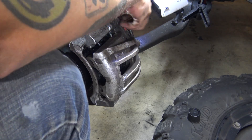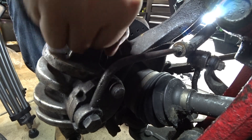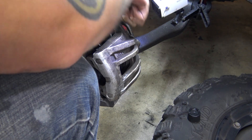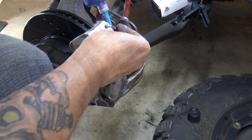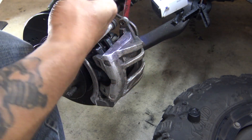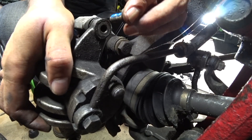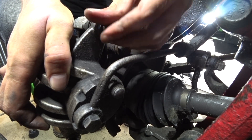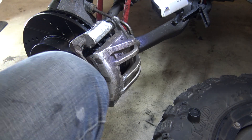These also have a torque spec — it's a lot less, only about 25 foot-pounds, not a whole lot. Let's just add our thread locker. Some people might be looking at that saying that's way too much — I know it is quite a bit, but this is some really old thread locker and I've noticed it hasn't been working to its full potential, so I've just been using a little extra.